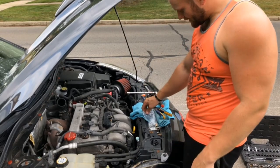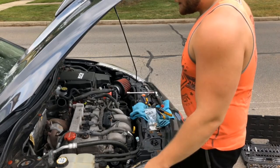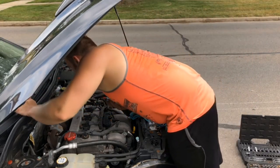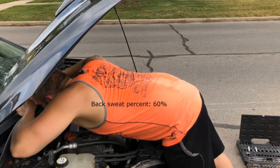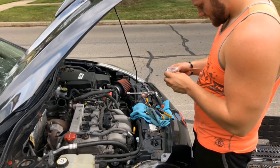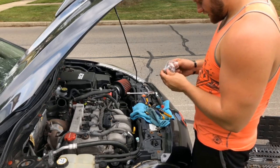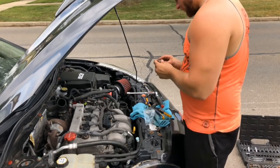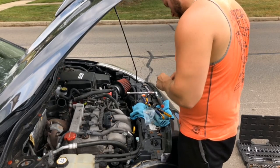You want a more restrictive oil banjo bolt because these cars' turbo gaskets suck anyway, so you really don't wanna have to buy them too often. As for the washer, I only see one on the stock one, so Damon Motorsports gives me two but I'm only gonna throw one on there because that's all I see on the stock one.